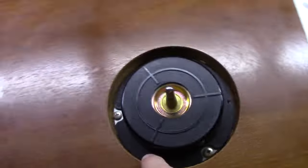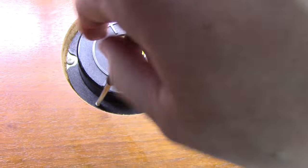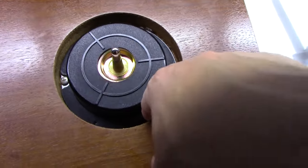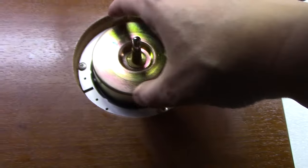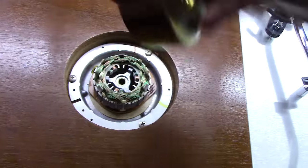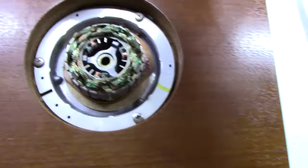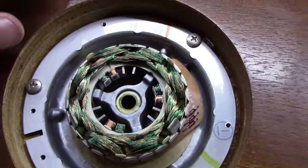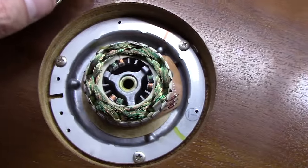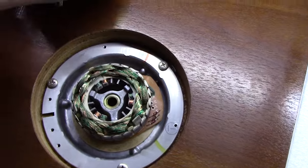This spindle assembly has three little screws — one, two, three — that you want to take out; they just hold down the plastic dust cover. Do not remove the big screws — those go all the way through and have bolts on the other side holding the whole mechanism into the chassis. Once you get the cover off, you can see the top part of the electric motor, which pops right off. And look at that — the bearing wheel is dry as a bone. Not a drop of oil, grease, or lubricant left in it. I'm going to clean it out with q-tips in case there's old dust or dried-up grease.